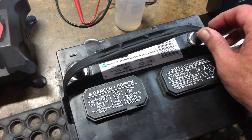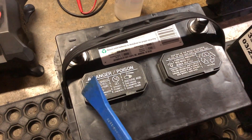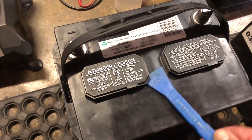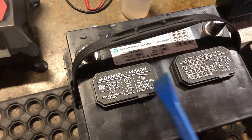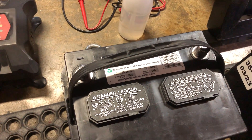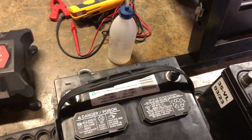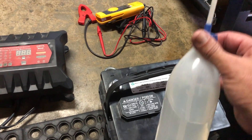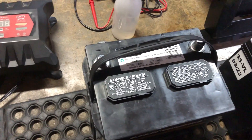Another helpful thing is every year or so, pop open the caps. The three cells are exposed once you remove each cap — just use a plastic pry bar, carefully wedge it underneath, and pry up. Be careful, you have sulfuric acid in there, so wear gloves and eye protection. Make sure the fluid levels are above the lead plates, and if not, use a little dispenser filled with distilled or deionized water — not regular tap water — to replenish the cells, then charge the battery.